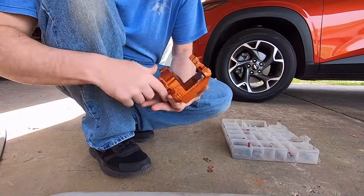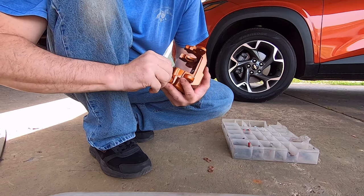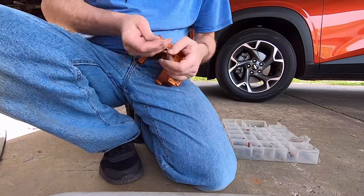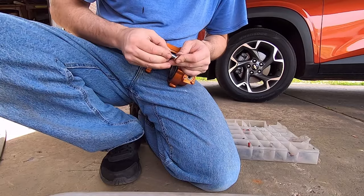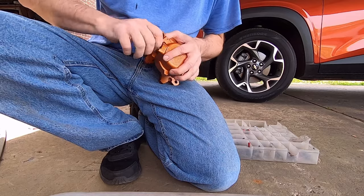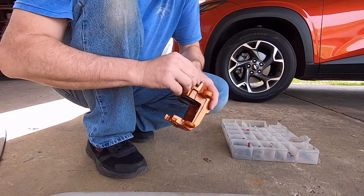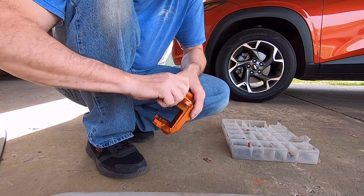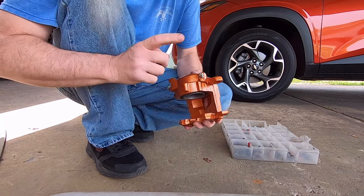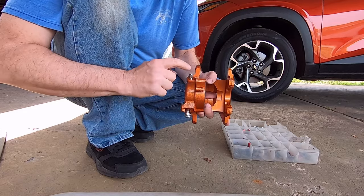Here are the calipers I painted the other day. I'm going to go ahead and stick the bolt through two washers and run it in a little ways, so when I go to hook the hose up the washers are already there. I put a vacuum cap in on the bleeder end. If you're ever doing brake calipers or a disc brake conversion on the front of a car and you pull the two calipers out of the box, make sure when you put your caliper on, the bleeders are up. Don't put the bleeders down — you'll never get all the air out. Make sure the bleeders are on top.